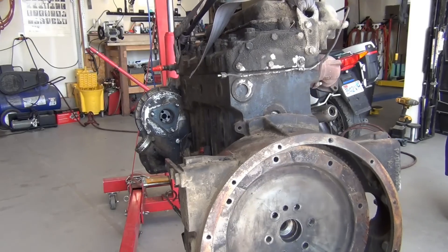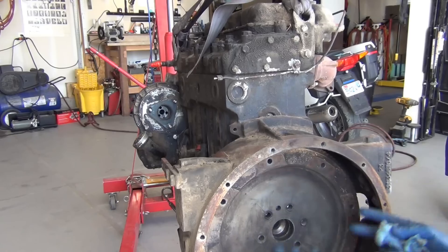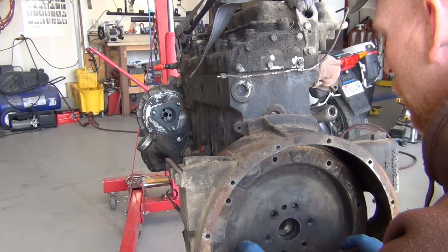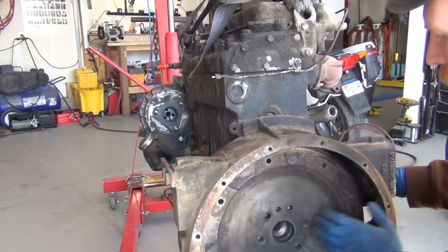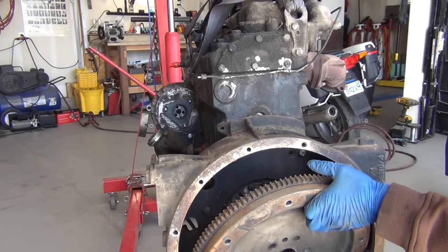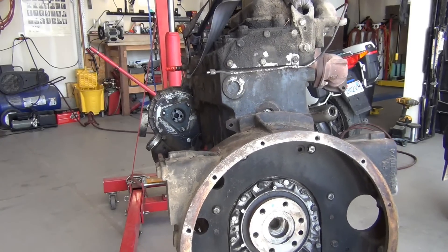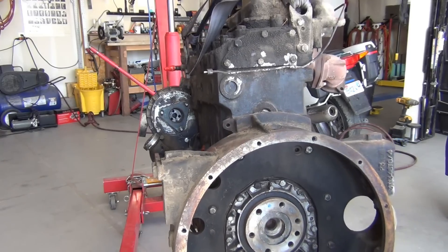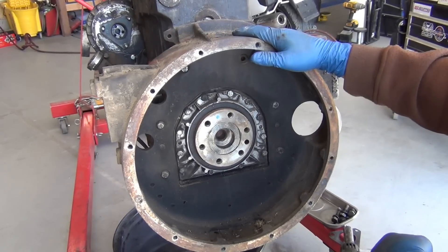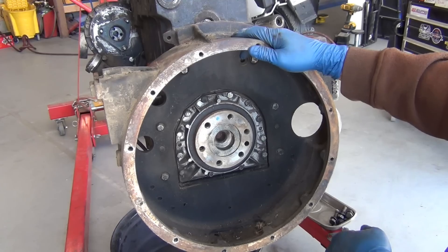Because the transmission on this is basically a big hydraulic unit, it's got a torque converter like an automatic transmission. It still has a heavy flywheel — this thing's a beast. It works like a flex plate; it's not thin like a flex plate, but it works like one — just to line stuff up. You can push the flywheel off through the starter hole with a hammer. Be sure to catch it — if this caught you in the shin you'd sure remember it. It's like a 20-pound flywheel on a diesel. There's your rear main seal. As far as getting the bell housing off: you only get to the bolts by pulling the flywheel off, and you only get to the flywheel by separating it from the torque converter. Torque converter bolts come off through this hole as you rotate it — you'll see each bolt as it comes around, then stop when it gets there.